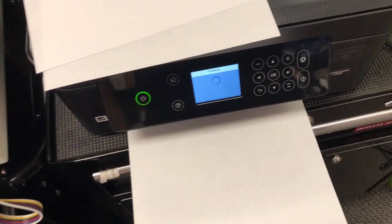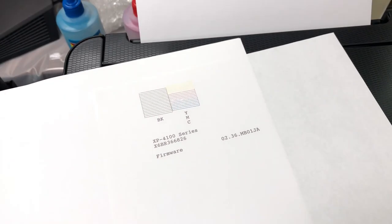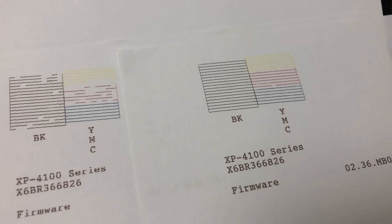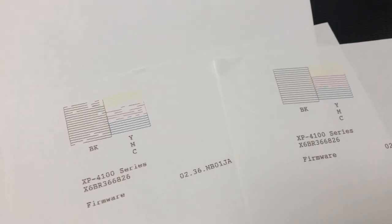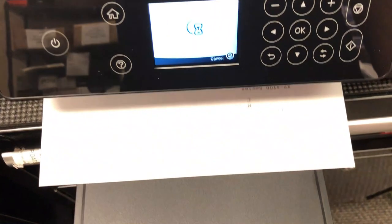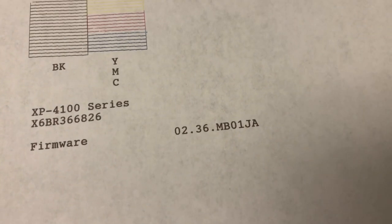Let's see the result — blank. What are we going to do? Six more cleanings. Now we're at cleaning number four. You can see there's only one pixel missing on the magenta. The third method took us from there to here. Should we keep going? I usually just stop and wait another 12 hours — normally that pixel will be gone. You might wonder why you had so much trouble. It's because when Epson ships the printer, they put some water solution inside. Sometimes the water solution is hard to get rid of — but this is the way to fix it. Wait 12 hours and that pixel will be gone.